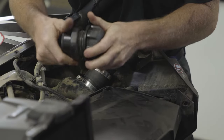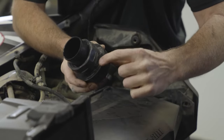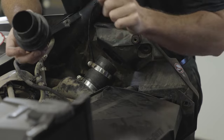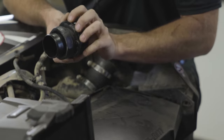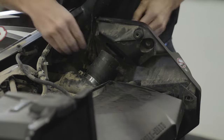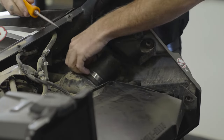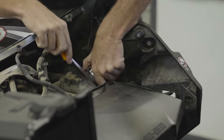With the fuel filler out, make sure to put the nut back on so you have the two in the same spot. Note that there are little tabs on either side of the fuel filler that index into the panel. That's important to remember as you go back together because you want those to lock in place — they're actually what's going to help hold the filler as you tighten the nut down. With the filler out, you can begin taking off the hose. You can wiggle the hose off, and if you're having issues you can use a screwdriver or a hose pick and lift on the bottom of the hose to help you remove it from the tank.